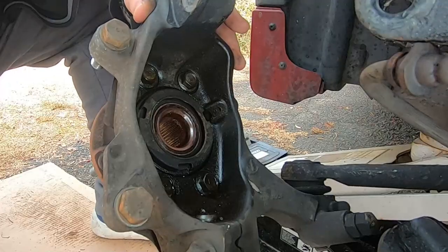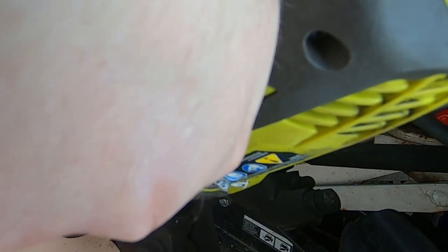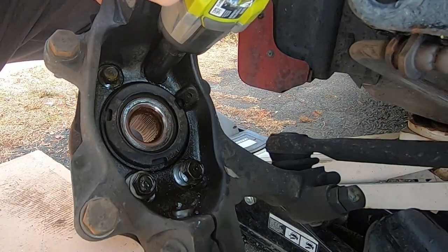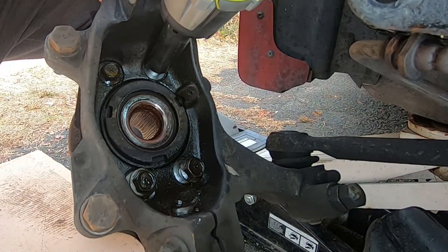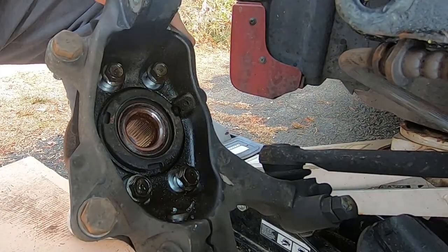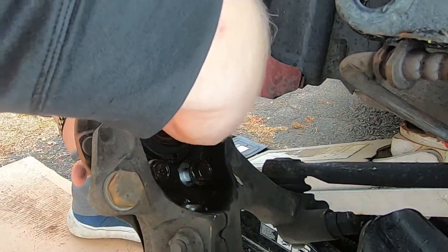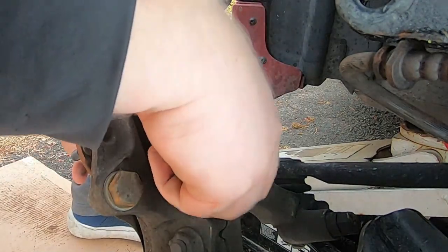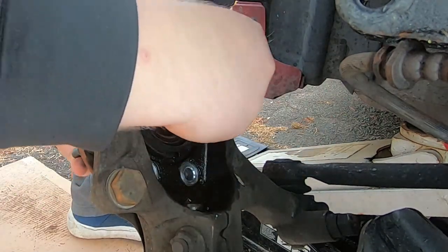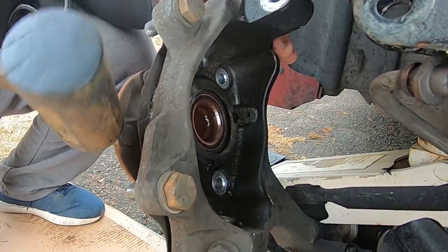You can also spray the front side of the wheel bearing as well. Now going in — just those four bolts, it's a 17 millimeter. Loosen up all the bolts and then take them out one at a time. When you're loosening, try to watch how much weight or pressure you're putting on that lower control arm. As you can see mine didn't just come out — had to bang it out.